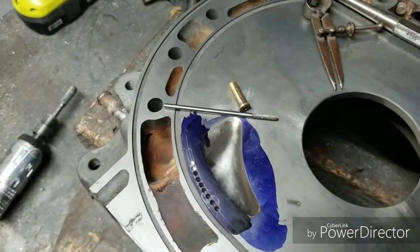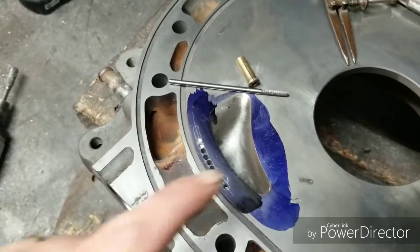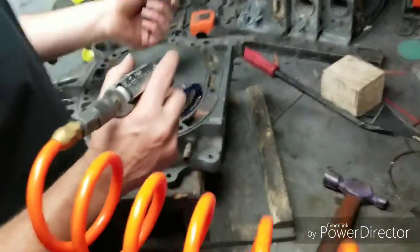Switching tools, we're going to be using our carbide bit. On the bigger porting jobs you're using a larger bit, but for bridge port we're switching to a small eighth inch bit. You can grind away the holes - the holes are really just reliefs to make it easier. And you're just connecting the dots.